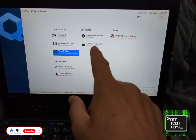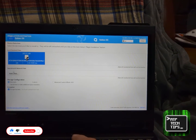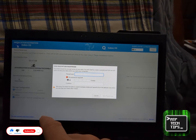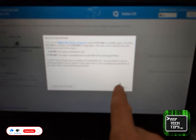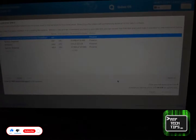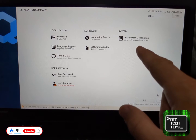Next, you'll need to select where you want to install it to. In my case it's going to be this SSD. Once I've selected the right disk I hit done, then I enter the disk encryption passphrase. After saving the passphrase, it mentions I need to reclaim space — this previously had Windows on it — so I hit delete all. When you hit reclaim space, it automatically partitions it for you.